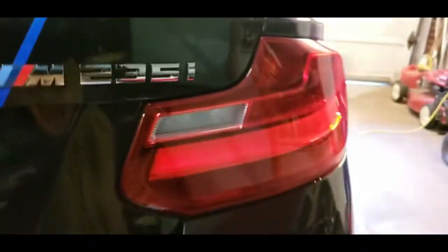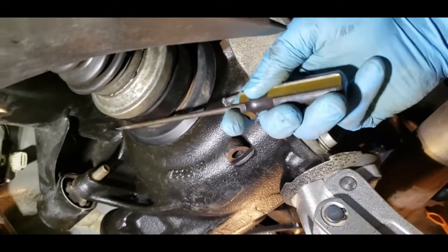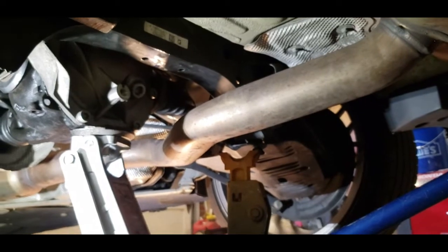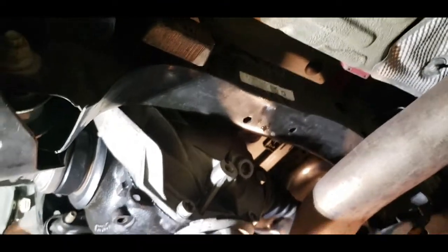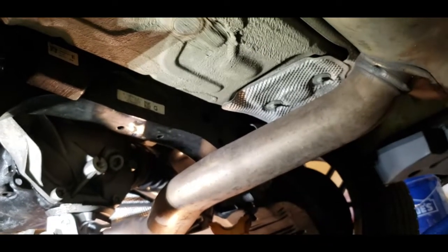To get those axles back in, I was able to just put a wood block right on the side here and tap it with a rubber mallet. The other side's a little more difficult but they popped right back in. There's a C-clip on them — the instructions say something like 'renew' — but they weren't hurt in any way. It's such a fight to get those axles out you have to have it at the right angle anyway, so I didn't see any reason why the spring steel on those C-clips inside there would be hurt.